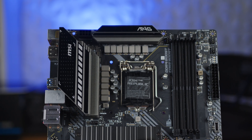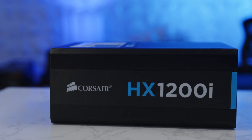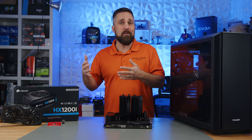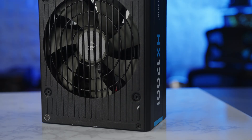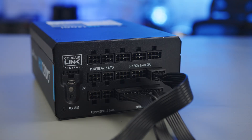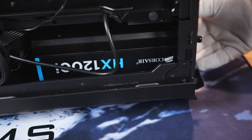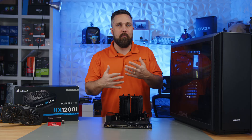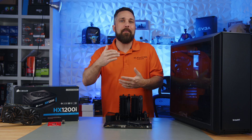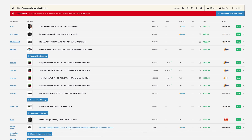The other area is the power supply. This is a Corsair HX 1200i — 80 Plus Platinum rated, 1200-watt, fully modular. It was overkill as a workstation, but it was extremely efficient and the fan never even turned on. While it's overkill for the server as built today, it gives loads of headroom to expand — I definitely see this utilizing multiple GPUs in various VMs. When planning your build, look at the power requirements of everything, add 20-30% headroom since you never want to surpass about 80% of your PSU's capacity, then step up to the next wattage tier.